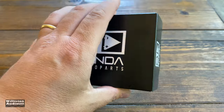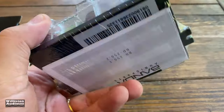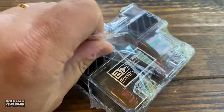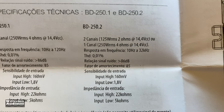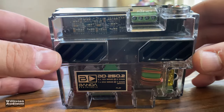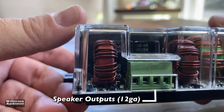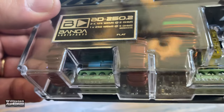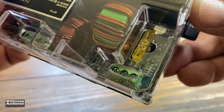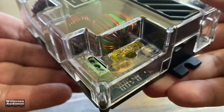Look how small it is — it's really difficult to portray how small these little tiny amps are. This one's actually much bigger than the Tar Amps, but still very small. It has a really cool acrylic case, and it has the owner's manual on the bottom — everything is in Portuguese unfortunately. It has 12-gauge wiring for the speaker outputs, and on the right side you can see the remote, the 12-volt, and the ground — all 12-gauge connections. There's also a 20-amp fuse.